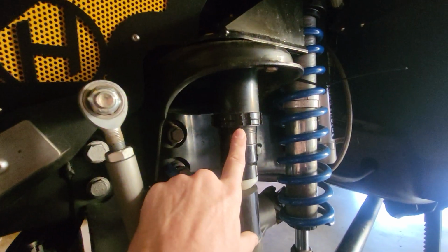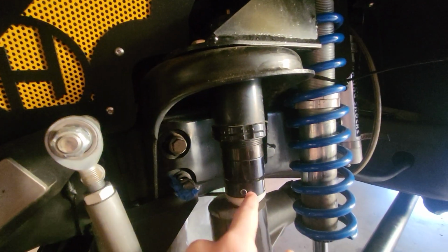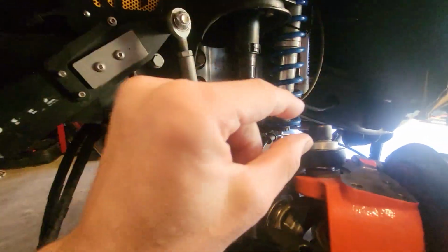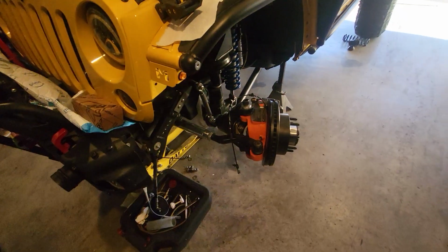With this hydraulic bump, it's adjustable. I can turn that in and bring it up slowly. I mean, we're talking 1/4 inch. And that will bring this up a little more. It'll bring my shock up so that I'm wasting very little, and I got a ton of down travel.